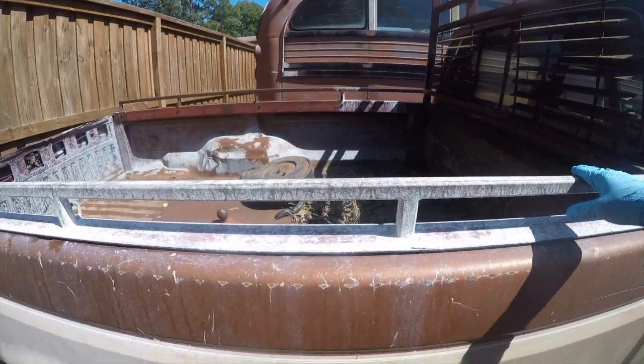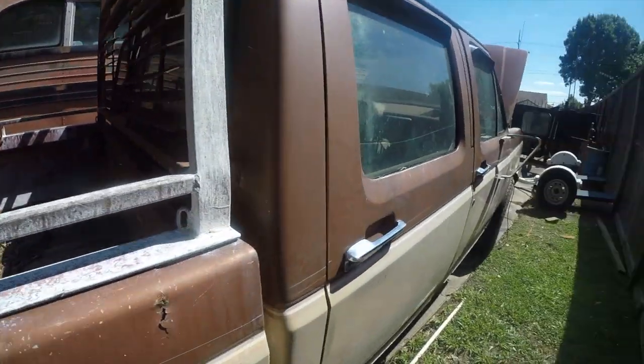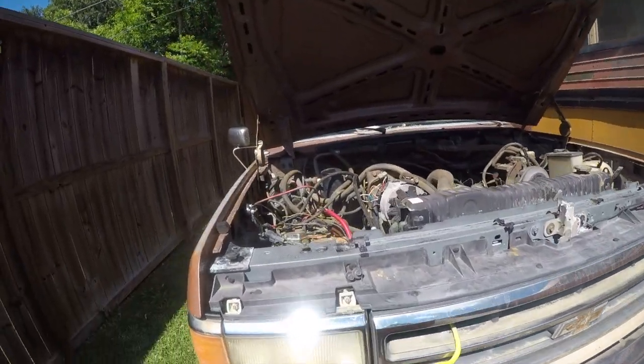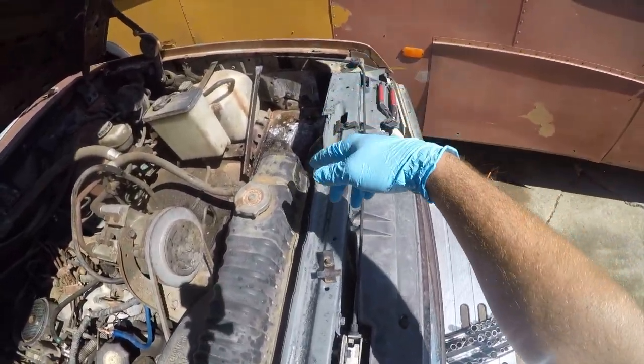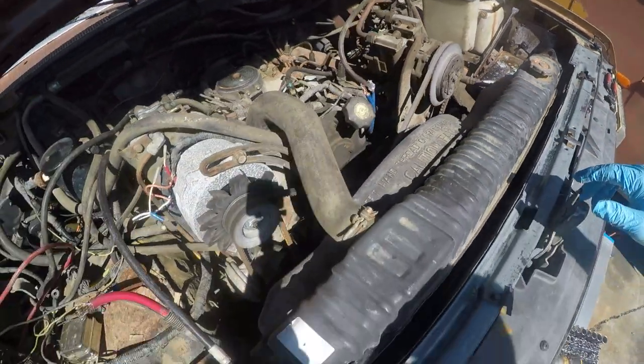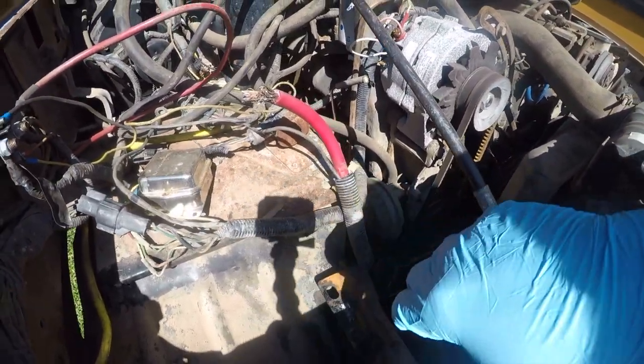I've already phosphatized these rails. That's why they're not rusty like the ones over there. Right now, I had kind of gotten a soft start on it. I was cheating on y'all. What I've done at the moment is taken the battery trays out, and that one I can't get out, so I've just treated it where it's at, knocked all the rust off of it. They looked like this when I started.